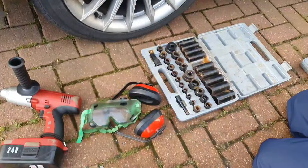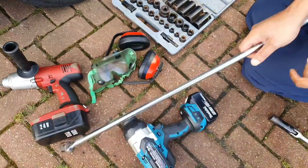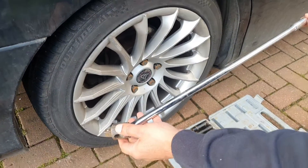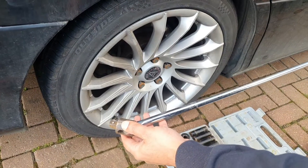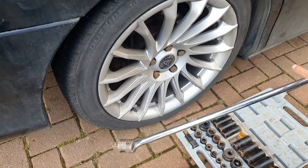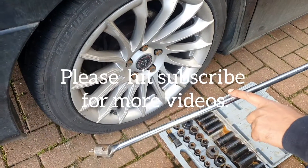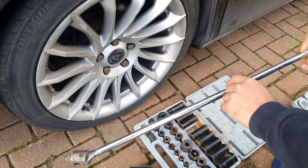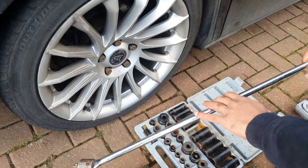If you're a smaller person or don't have enough power, you can use one of these longer ones — I think this is about 24 or 36 inches long, three feet. That will give you a lot more torque, but what you will find is that if there's a lot of torque, this bar can flex and become a dangerous weapon if it fractures. So you want to be very careful not to smash your teeth, because it can bounce.